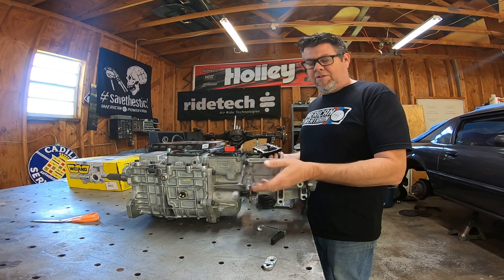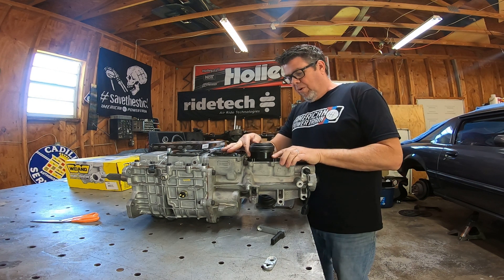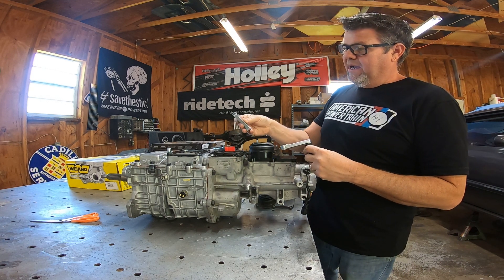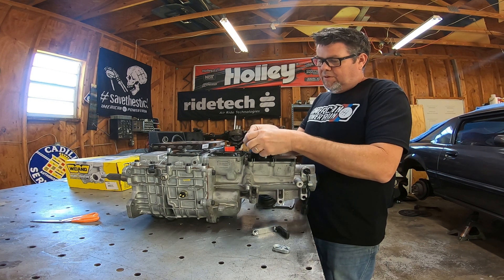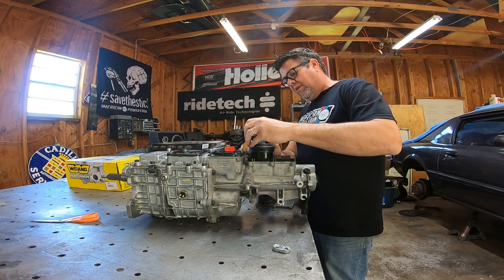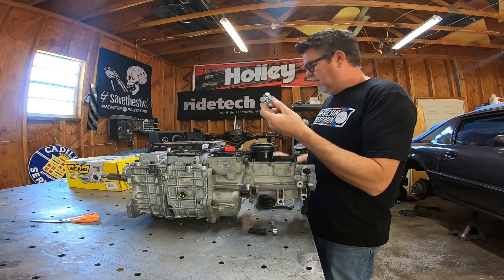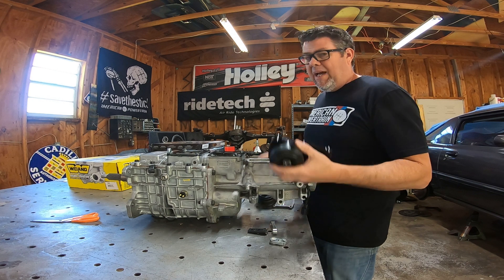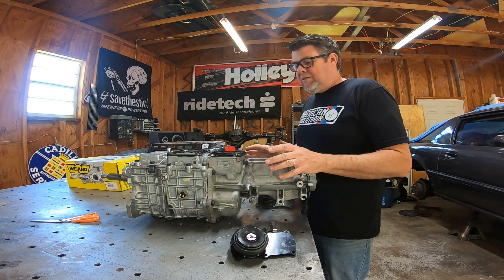Say you have a muscle car and you want it to look like the factory four-speed shifter position inside the car — we do that with our Revolution shifter plate. It goes on like so, and then we have these dog bones, which are little offsets. For example, on a second-gen Camaro you'd put your dog bone on here, your shifter stub goes on here, and then you bolt your shifter handle to it. We can do one-inch offset, three-inch offset, up to four inches. We have all the muscle cars figured out with the correct dog bones for the right shifter location.